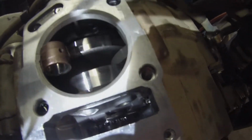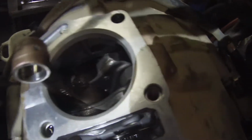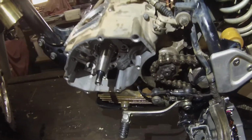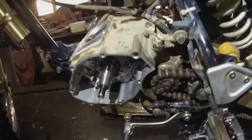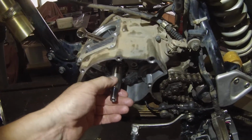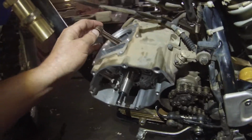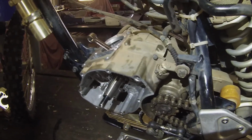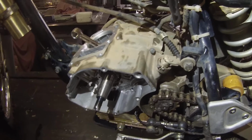And I thought if there's something wrong with that, which there shouldn't be, there's only a couple of gears and a couple of bearings, then the whole case has got to be split. And on the internet someone mentioned something about a Kickstarter idle shaft cracking and causing shakes. I thought, no, I don't think that's going to be what's going on here. One of the signs was, with this rattle, it sounded like maybe a big end bearing or a little end bearing or something like that.